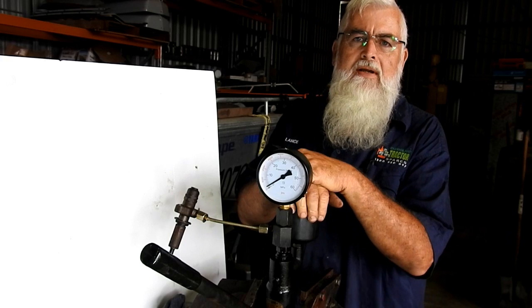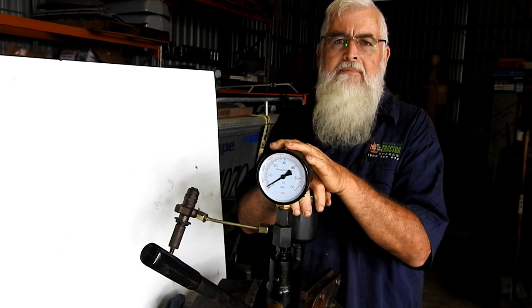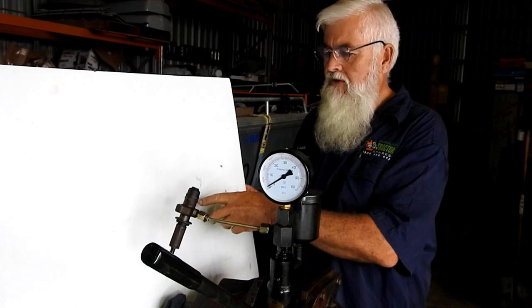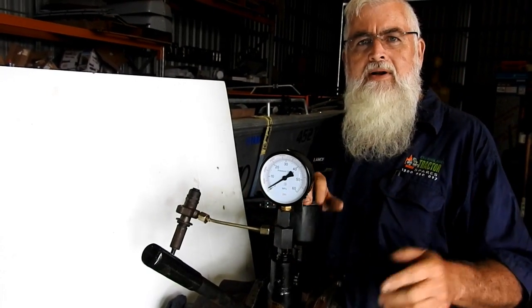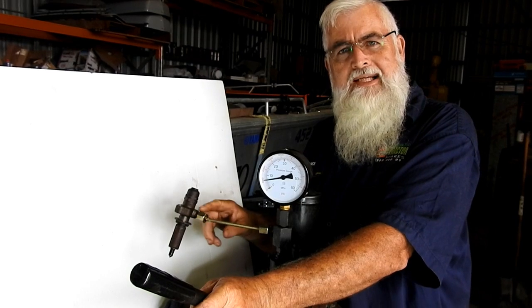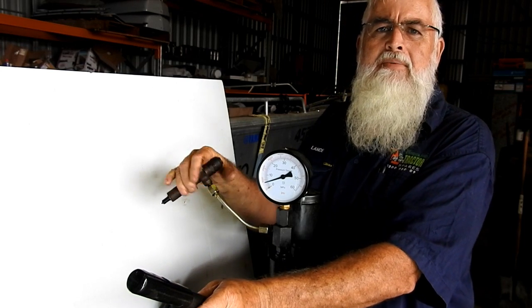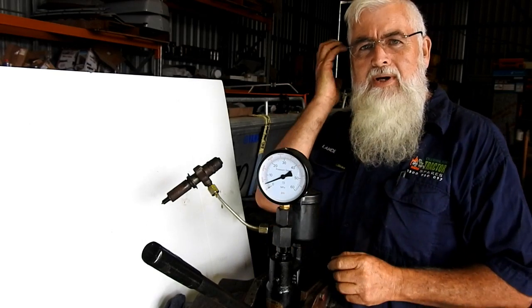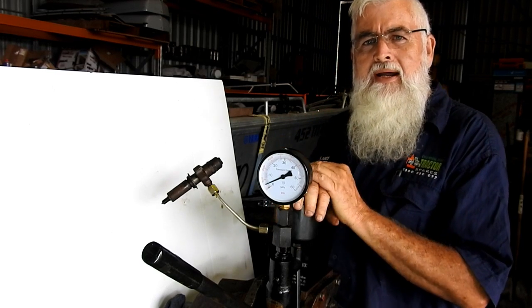I told you in a couple of episodes ago about the diesel injection tester playing up - I've got it going, cracking away. I've got a piece of cardboard, an old sign, sitting behind to try and show you what we're looking at. It's a bit hard to juggle everything, but when we pump the handle here that imitates the fuel injection pump and puts a bit of fluid out of the injector. I've bent that pipe to get it up here so you can see it better. When it gets up to around 2,600 pounds per square inch, we're looking at a chirp and a spray pattern.